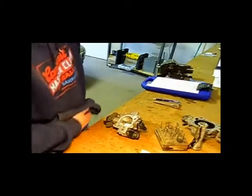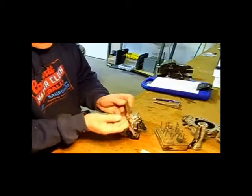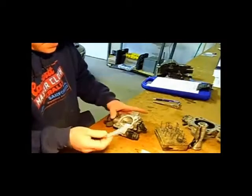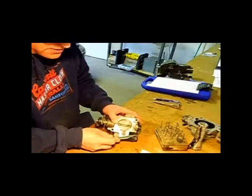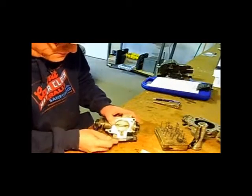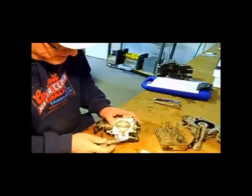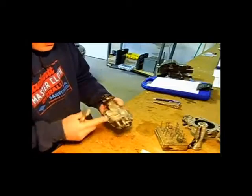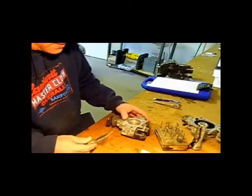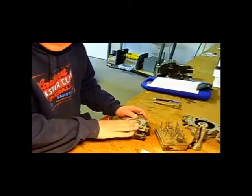One thing that you'll find extremely important to have in your Gadgetman operations is a good, sharp pocket knife. Because what you can do to speed this up until that JB Quick hardens all the way is you can take and slice it back and forth like this. You can see the scrape marks from where I've done this throttle body that way too. And you just take and cut it off like that, and then you examine it. And if you're smooth, you're good to go. You can tolerate a couple thousandths of an inch without a big deal because you've got a gasket that goes here.